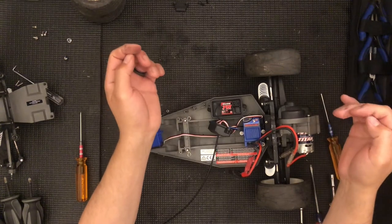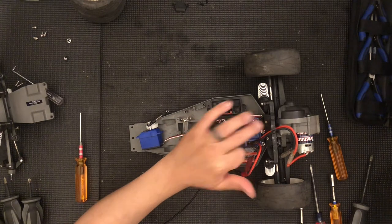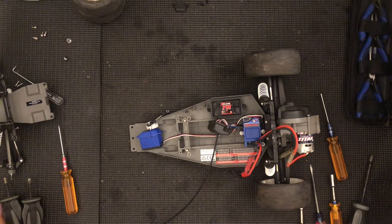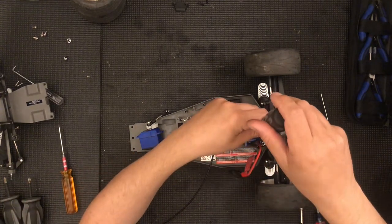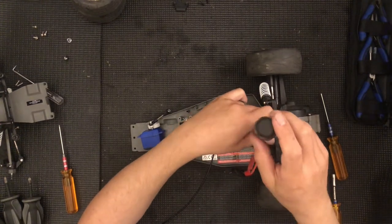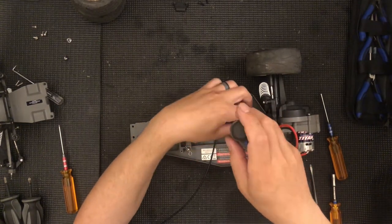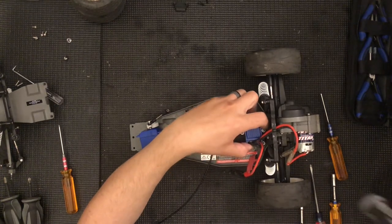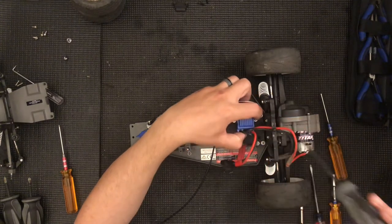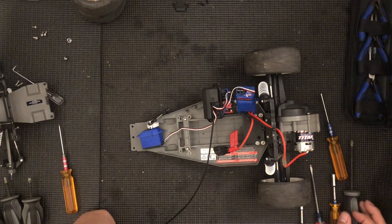Use tie straps instead. You just need to remove these two screws right in here. And if ever you need to replace screws, just get hex screws — hex screws are much better than Phillips screws. Phillips screws are probably used because they're less expensive, but there we go. So I've gone ahead and removed this.